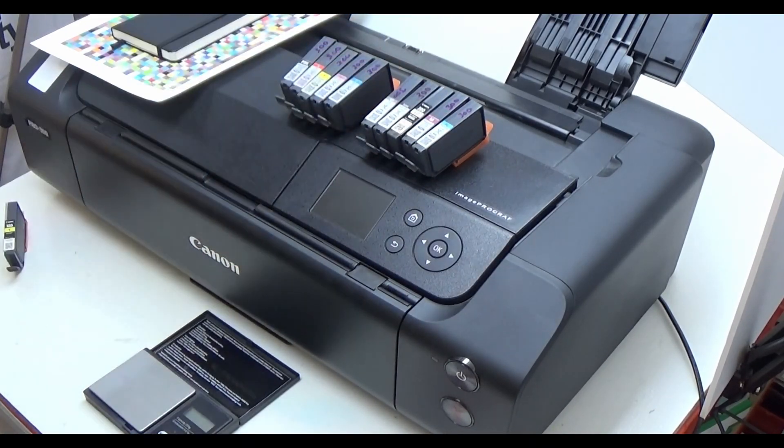That priming routine pulls ink from the cartridge to clear the channel of any bubbles and potential clogging, leaving the printer ready to print. The problem is it doesn't just do it on the cartridge you changed — it does it on all of them. So if you change one cartridge in a set of 10, which is what we have with our Pro 300 here, it will draw ink and waste it for all 10. That waste ink goes into the waste pads in the printer, and there is a finite capacity for that — so each time you change a cartridge out, you're wasting additional ink and also reducing the lifespan of your printer.